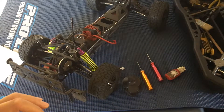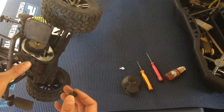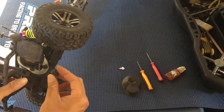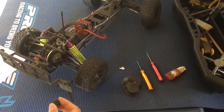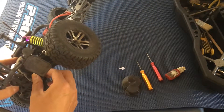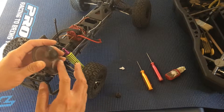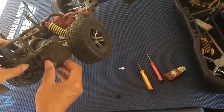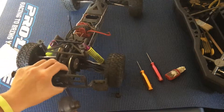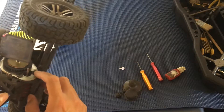I had sized this up because I think we were running a 12 or 13 tooth before and it just didn't have the top end speed I wanted, so I went to a bigger pinion. This was the only one we had on hand — we'll probably need to get a 17 or 16 tooth and try that. With the 18 tooth, I just couldn't get enough spacing between the gears, so it was running hot. You could actually feel the heat from the friction on the gear cover. After running it for a couple minutes I put my finger there and it was noticeably hot — only a couple seconds before it was too hot to keep there. You can actually see the dust from that additional friction.